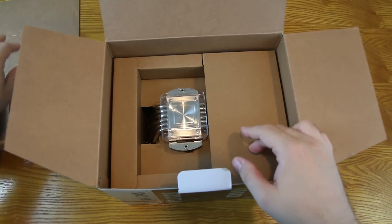Easy to install, I think it looks nice — I happen to like the look of air coolers. You do have the option to put another fan on top if you want to do push-pull and you got the space. I think this is really good for a small micro ATX build. The case I have for the Home Theater PC has a micro ATX motherboard, so something like this would have been really beneficial there. Noctua did redesign this so that on certain ATX boards where the topmost PCI Express slot is really close to the socket, this supposedly eliminates that clearance issue. So you should be safe other than ITX on your PCI-E clearances.